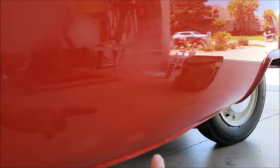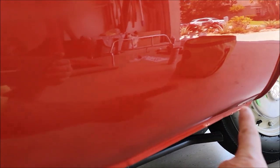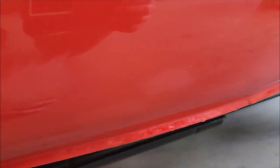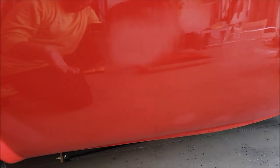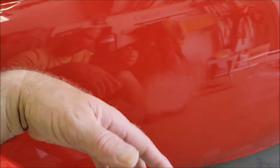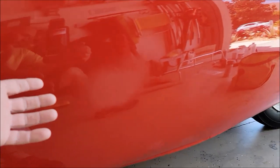I went ahead and got some more of the orange peel off this section and worked that section a bit. The best rule of thumb when doing any polishing or sanding is use the least aggressive method first — just try something light even if you know it's not going to work, and work your way up to more aggressive because you might be surprised. Down here there was a bunch of overspray — I tried to clay bar it and it didn't really want to come off, so I just sanded it off with 2500 grit. There were a ton of dust nibs in this thing. I'm not going to sand and potentially go through — the readings are all over the place.